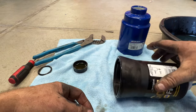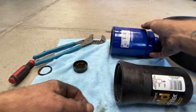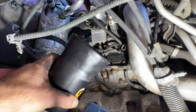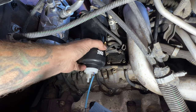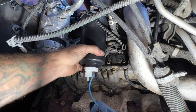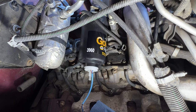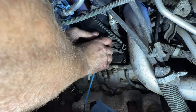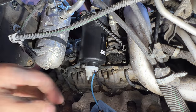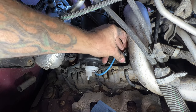Now we can go ahead and put it in the truck. Just check on this one as well, to make sure that o-ring is on there and came off with it. Take your new filter and get this up in there. Again, just make sure this gasket's in place correctly and go ahead and screw that on. Then plug in your sensor — just like that.